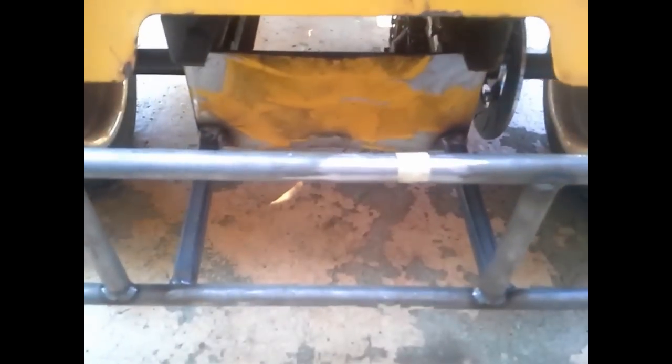We're back, down to using the crappy camera again. Got the bumper welded on, all squared up, just bottom braces on the corners. Got the rear brake assembly mounted — nothing's tight, it's all just mocked right now. The disc is on there, and I took the caliper and bolted it to the actual frame and through the angle iron.